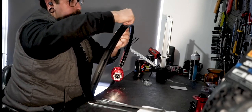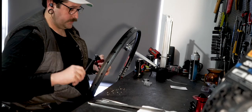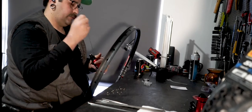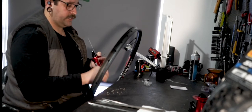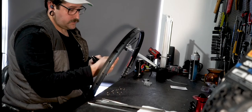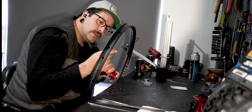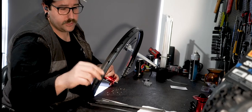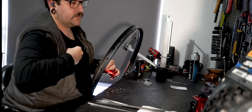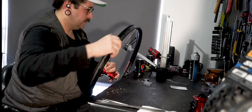There's already a washer in there from lube. I'm going to put this pro-lock thing on — the alloy pro-locks act like a washer, so good to install. I get my next spoke, insert it two across, loop it through, and give it a nice little bend. You want the head of the spoke to be on the outside of the hub. You bend it in, let it settle, then go one, two, three, four — and in the fourth hole across you put this one. I make sure to grab the washer for that one.